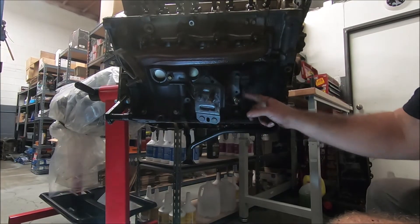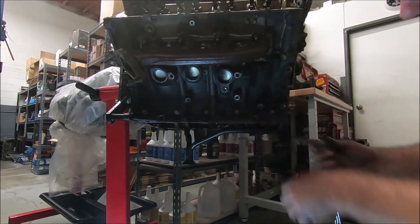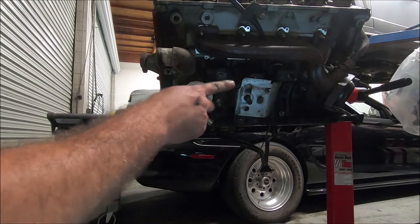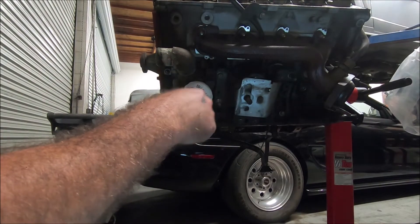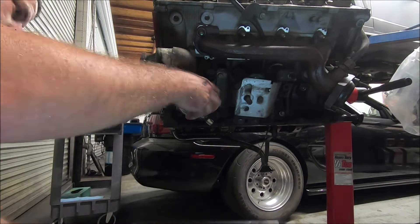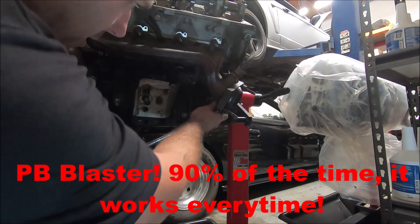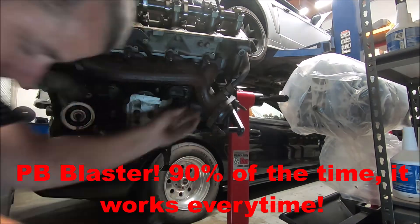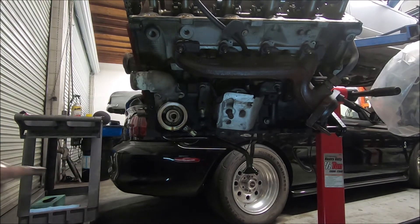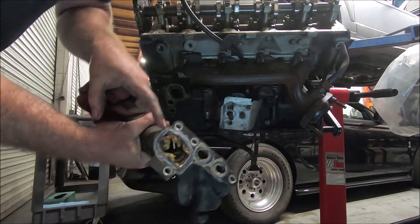The plug on this side is back behind the motor mount so I'm going to go ahead and take that off. You can see the plug there. Back over on the driver's side, while we're waiting to see if the PB Blaster will do its job on the drain plug, I'll go ahead and take the oil filter off. The other thing we need to keep that goes on the other engine is going to be the oil filter adapter, so we'll take that off.